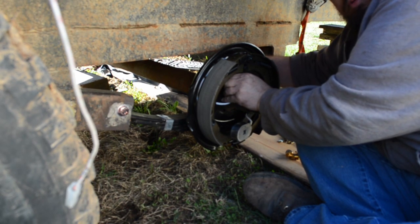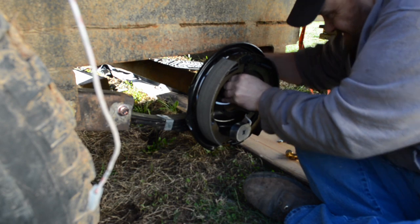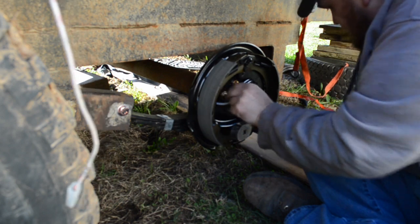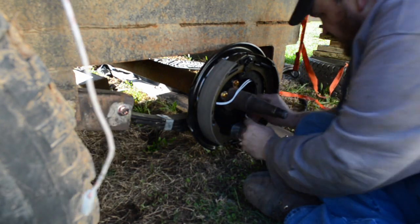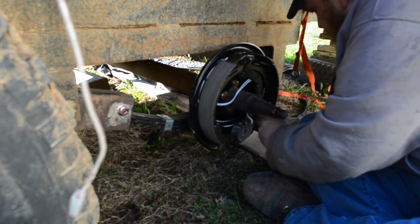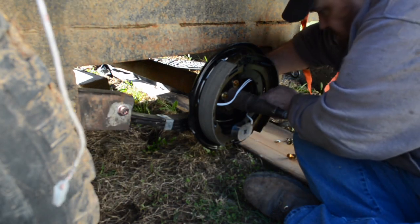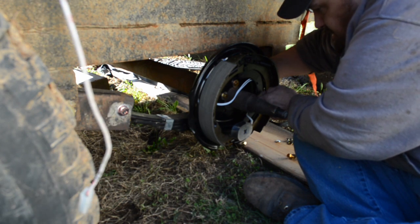Any longer bolts wouldn't have worked. Wouldn't have? And then it would have hit that U-bolt. Oh, yeah. We got 1-inch grade 8 bolts to hold that backing plate on. Probably don't need grade 8. It's supposed to be nuts on the inside and bolts on. Yeah. It's also supposed to be like studs gets driven in there.